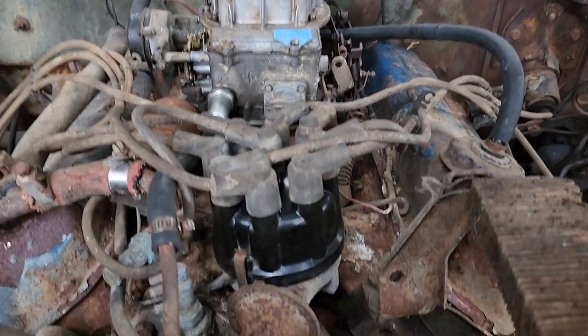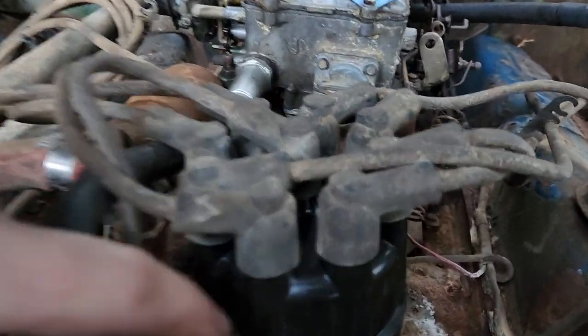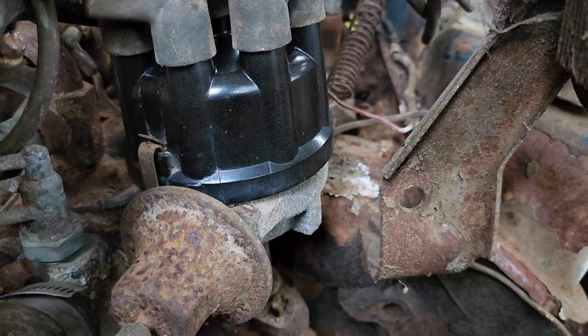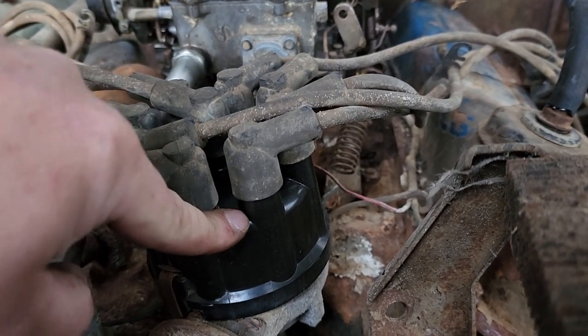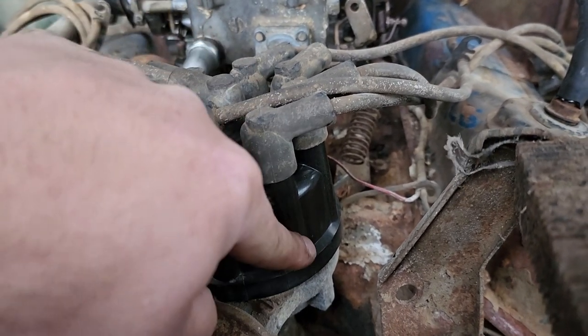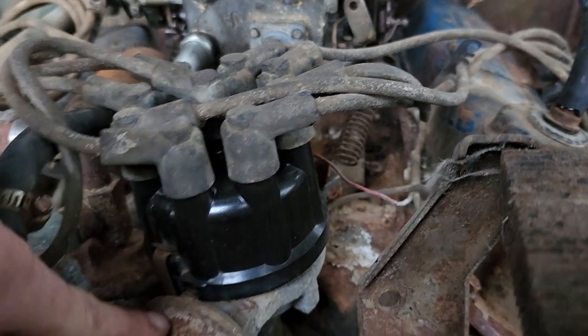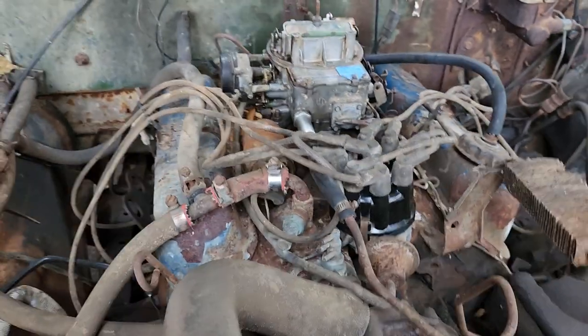As you can see here, this looks nice but I just cleaned it up really really good. I went through and took it all off completely, took all the wires loose, cleaned it up really well, cleaned all the points inside the cap, cleaned the rotor a little bit more, and also cleaned the points on the distributor again.